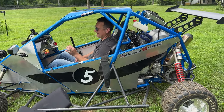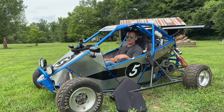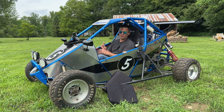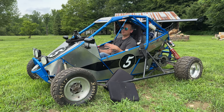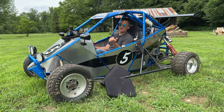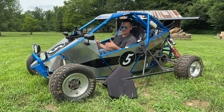I highly recommend that if you're going to get a donor bike, ride it before using it as an engine. The donor bike I got for this I rode on the street for a couple of weeks before I pulled the motor — it had a strong idle, tons of power, and smooth shifting. If you just buy an engine out the back of a van and put it in here, you're potentially facing a lot more problems along with fabricating an entire cart. It'll cost a little more to get a full bike, but it's worth it. Pull the motor, pull the harness, then sell the parts — the wheels alone on most of those bikes can sell for like 800 bucks.